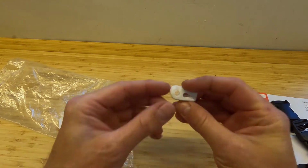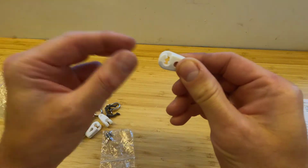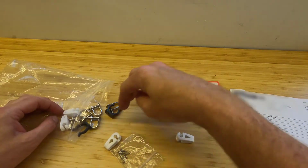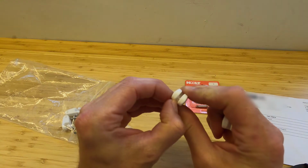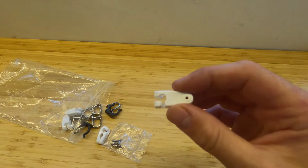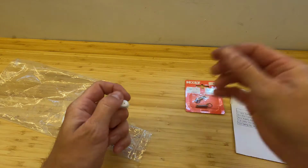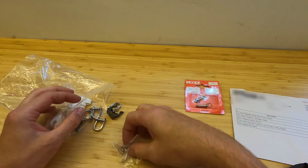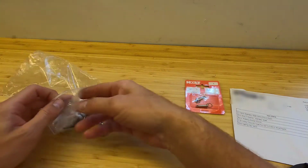I think these come in a pack of 5. These are just the clips. What are they actually called? They're called Jib Hanks, and these are the twist-on hanks that put the jib onto the front shroud. So I got 5 of those. I just bought one because I think one of them's wearing a little bit. They're a little bit wide here and they fall off sometimes. So I might replace a couple, but the other thing was, I think it'd be good to have an extra one down at the bottom to see if I can resolve the jib creasing, because it's being pulled too high. So that'll be interesting. I can try that. I think it's only a screw hole that goes through the sail. I can't see that being all that bad.